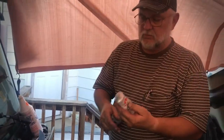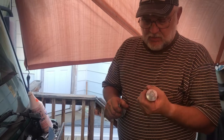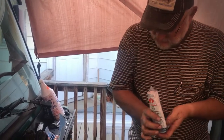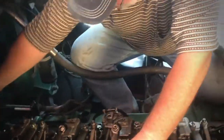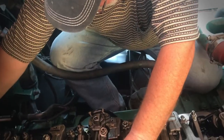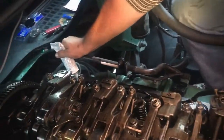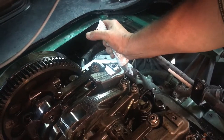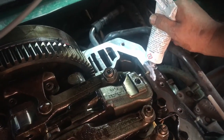What we're doing now is I've got an International T442, which is an RTV silicone rubber. This is actually formulated so that oil won't break it down — it's got additives in there, some calcium, things like that. We're going to use this back here on the back, going about an inch and a half or so from the inside of the lip, and we're just going to lay a bead down right in front of that lip. Then we'll go about an inch to an inch and a half past, and we'll do the same thing on the other side.